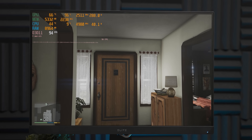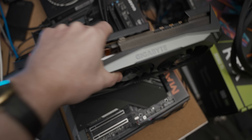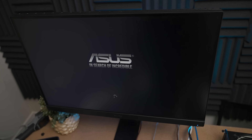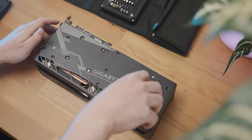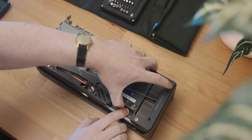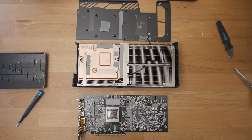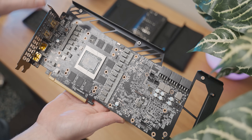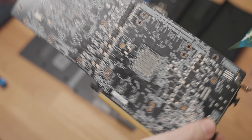The only thing I haven't tried yet is changing the testbed out entirely — putting a different system in there to see if that does something. Okay, it just launched in a completely different platform. And then my final idea was to tear the graphics card down to see if there were any obvious problems on the PCB, but considering there wasn't any throttling going on I wasn't really hopeful. Aside from the vapor chamber looking like a forensic team's wet dream with all those fingerprints, it just looks like a really badass graphics card PCB and with my untrained eye it looks fine. After spending four days on this I couldn't really think of anything else to do.